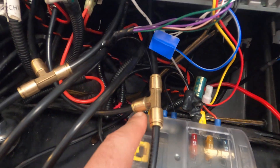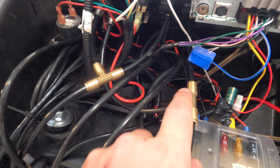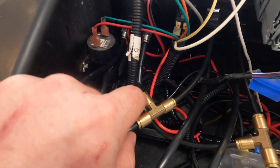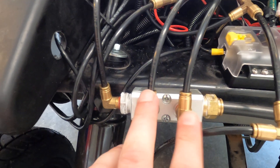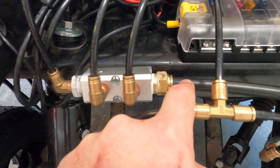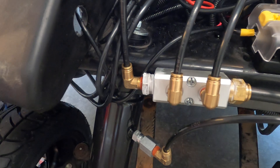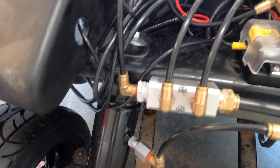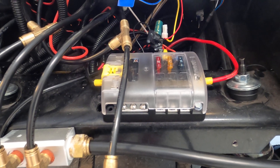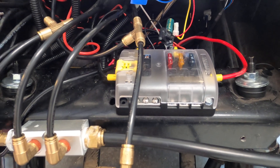For the suspension in the front and rear, we tee the bags together and then come off on another tee that runs over to the air gauge so we know how much pressure is in there. Same thing for the rear — this comes off the paddle switch, tees over into the air gauge. Air is distributed to the paddles via this little box here, with a half-inch coming in from the tank. This also feeds into the air pressure gauge so we know the tank pressure. We also have a fuse box that takes power from the converter and distributes it to the head unit, air compressor, lights, and everything.